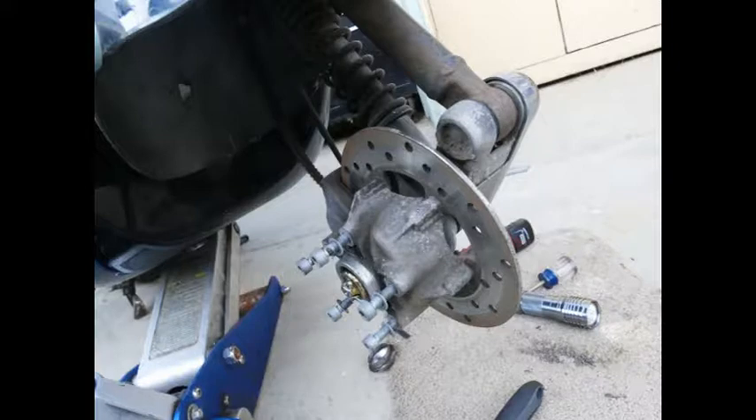Next, there's the mono-arm front suspension instead of a fork, which introduces several issues. Starting with the benefits: it's very easy to change the tire — you just unscrew it and take it off. On most motorcycles, you have an axle that you've got to pull out, and it's kind of tricky to get back in.